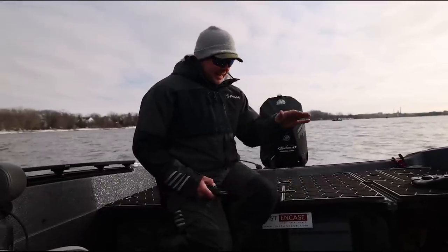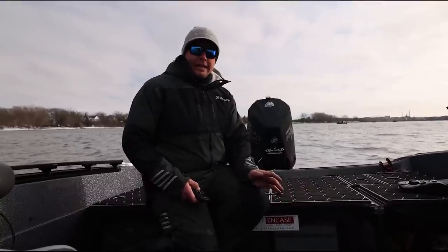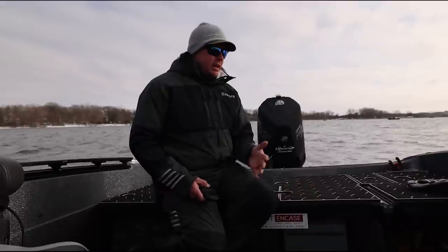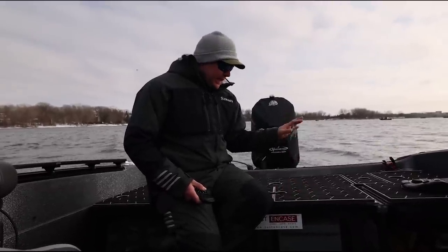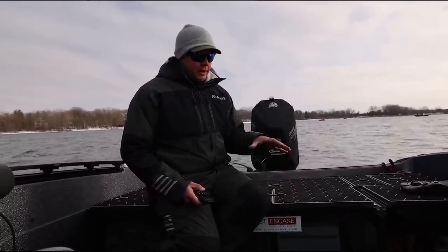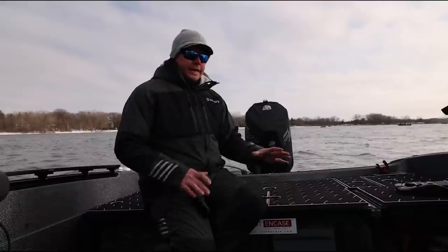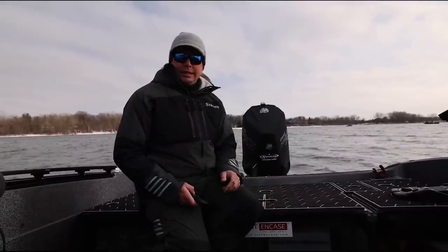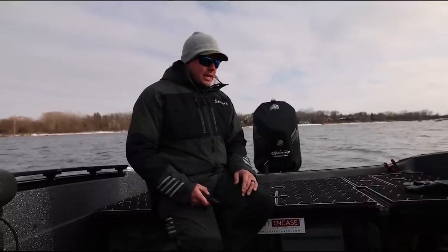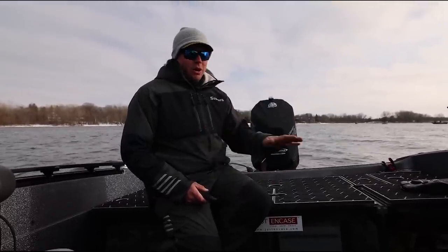Last thing in the back: our batteries for the starting battery and house battery. I just have a standard lead-acid starting battery right now due to some Mercury warranty stuff — Dakota is getting their batteries cleared by Mercury soon so you can run a Dakota Lithium starting battery, but for now I have a stock battery. I do run the 12-volt, 200 amp-hour house battery from Dakota Lithium. This thing is an absolute beast — I took it out of my last boat, put it in this one, and it'll charge and power all the graphs I could possibly need. I never got a single low-voltage warning last year even running five graphs. If you need a house battery and have issues with graphs dying, that battery will solve all your problems.